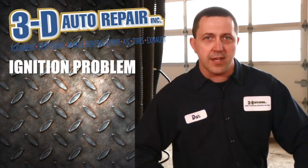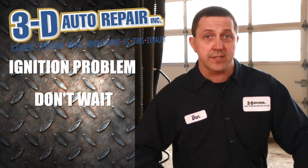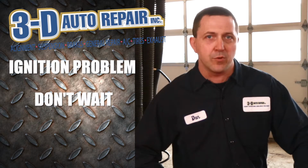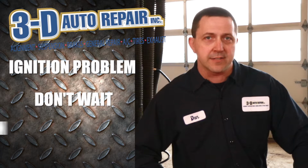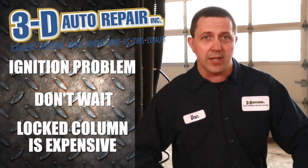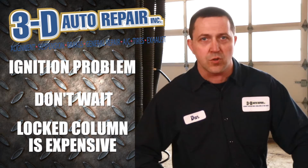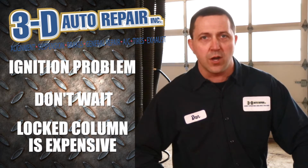So if you think your key isn't working correctly, the big thing to do is to make sure you don't wait until it stops functioning completely. We have to be able to turn the key to remove the ignition lock cylinder from the steering column. And if it gets to the point where we can't turn the key at all, then we have to drill it out, and it's exponentially more expensive for the consumer if they wait too long, to the point where the key won't function at all.